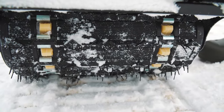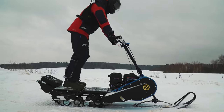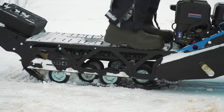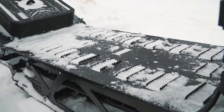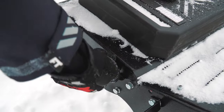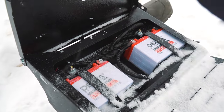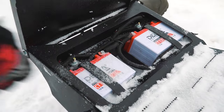There is a track with a length of 2070 mm and a width of 380 mm, with roller suspension — as a result the snow scooter is quite bouncy and the suspension is felt on the move. There are hooks on the platform, but I think they need to be enlarged since they freeze very quickly. A canister is fixed in the back, which will never be superfluous. Under the cover we see the battery compartment. With the engine in the front and the battery in the back, there is excellent weight distribution. It would also be nice to make the battery compartment waterproof so that snow does not get in.